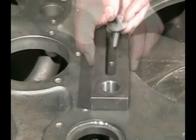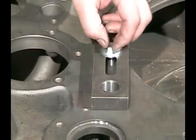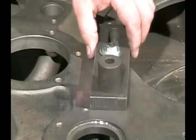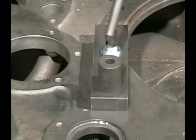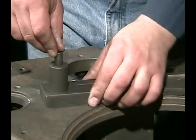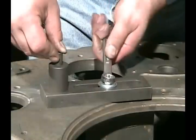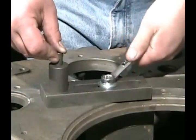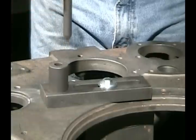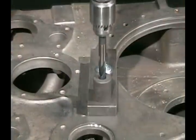We put the strength into that bolt hole and limit the spreading force of the bolt when it's tightened, which would work against the repair. We set up and use a full torque thread replacement insert. We start by placing the right angle drill fixture on the casting using the alignment pin — the tapered alignment pin — into the hole, and tighten the drill plate down onto the casting. Remove the alignment pin, and we'll drill the hole with the proper size drill bit all the way down through the wall of the casting.